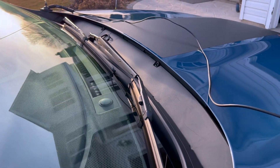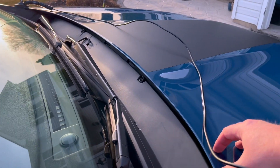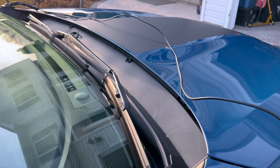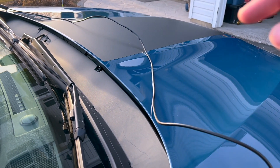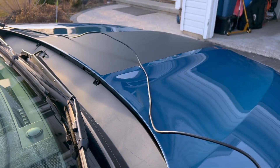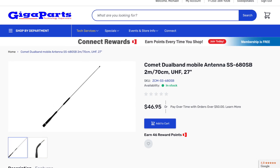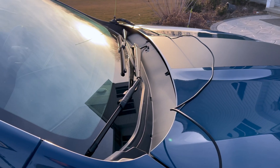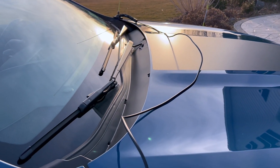If you made it this far, here's what I've been thinking about for my dilemma. If I was going to put antennas in the front, I've been thinking about two options. One is the ditch light brackets which go in underneath and come up over the top of the hood - probably a bit more stable on the highway. The holes would need to be drilled out a little more, but I could put in NMO or SO-239. I'm likely considering one of the Comet antennas, probably the 27-inch one, because I want to be able to get in the garage without having to fold it down.